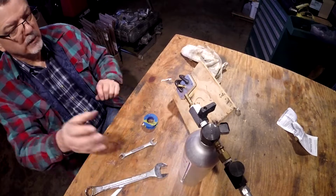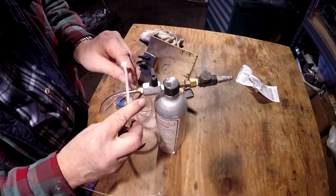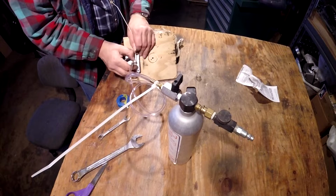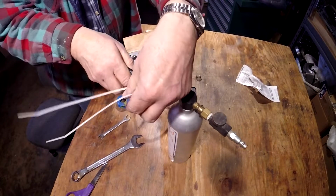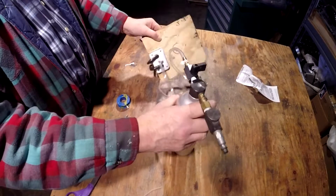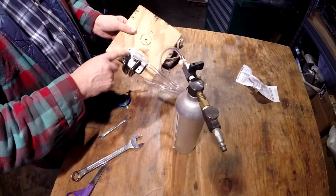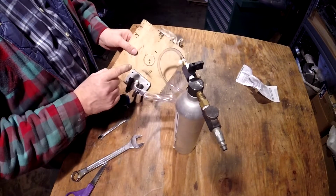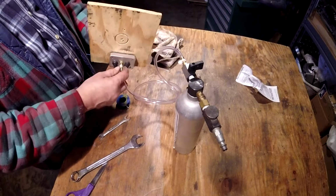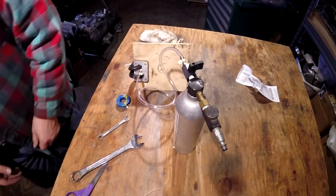Okay, so now the hose. Okay, there's the idea. DOT 3 in here, up to about there. 15 psi there. This gets screwed down. I have some longer 4mm screws for the cap, and then I should be able to blow brake fluid all over the place. Hopefully not, it'll be contained and go out.